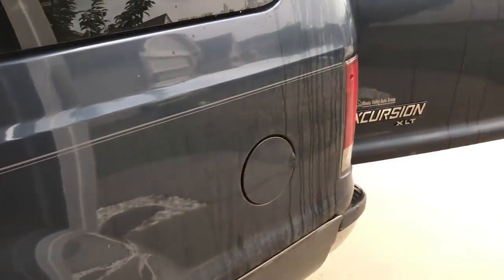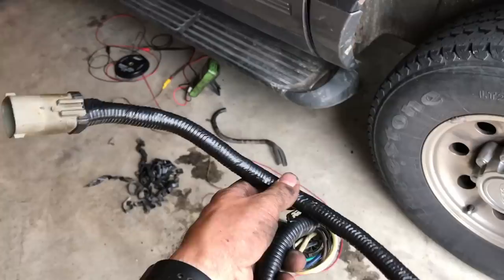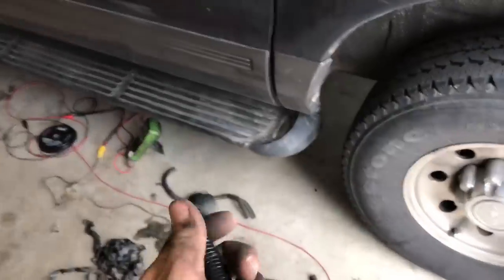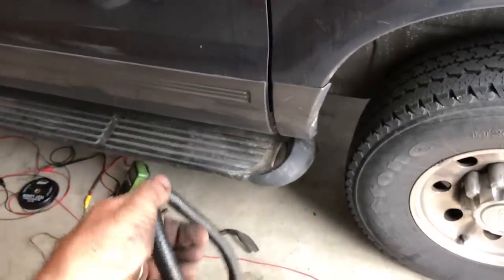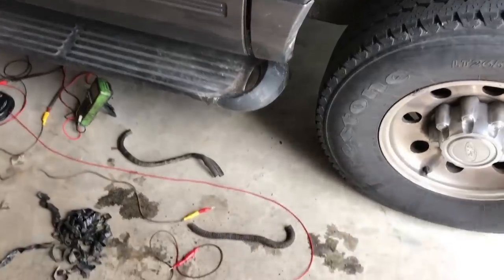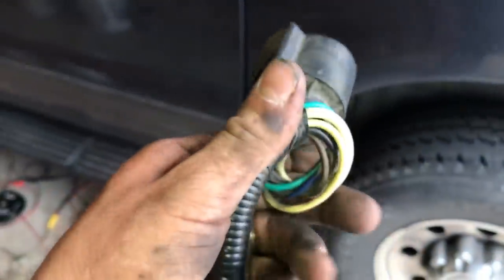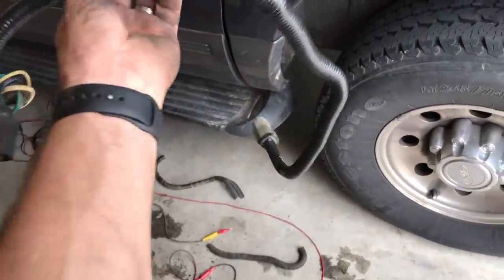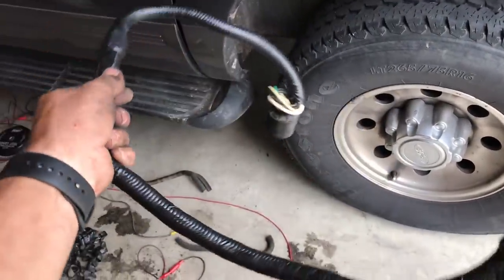I'm going to see if I can find a replacement harness and throw it in the truck. I looked around and found some similar harnesses, but wasn't finding exactly what I needed, so I went ahead and repaired this one. I redid the wiring cuts with a little bit of solder and heat shrink and repaired the wires. Everything has good continuity. The red wire was cut a little short so I had to wrap the excess wire around there, but otherwise this harness is really protected — electrical tape all around it inside and outside the wiring loom, so it's in good shape.